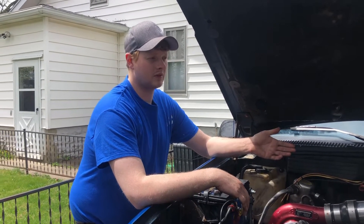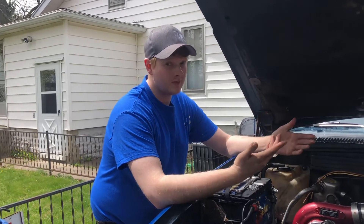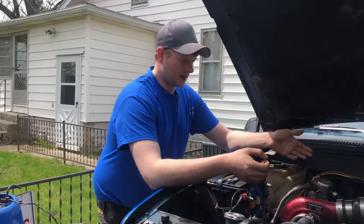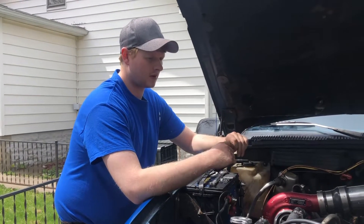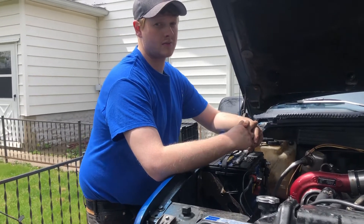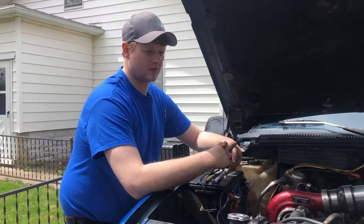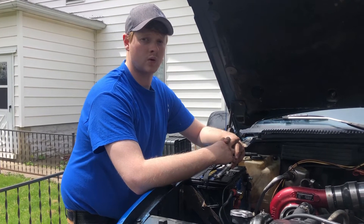People use torque-to-yield bolts and they work fine. Casper still has the stock ones from General Motors in 1999 - I beat it daily and it hasn't lifted the head yet. So I'm not convinced head studs are a necessary evil. But in this case I can't say this was a fault of the bolts or torque. Something I want to say is: if you follow the torque-to-yield instructions from GM...